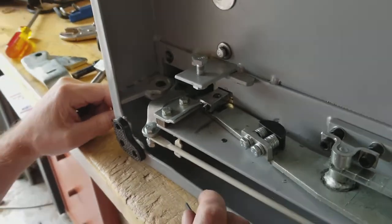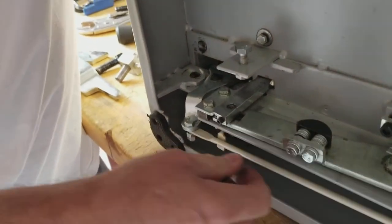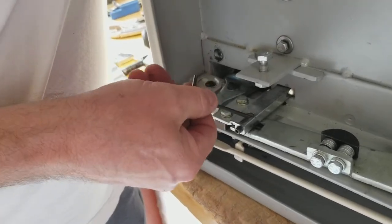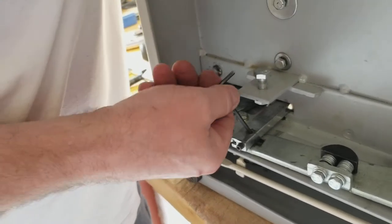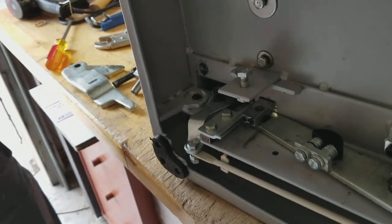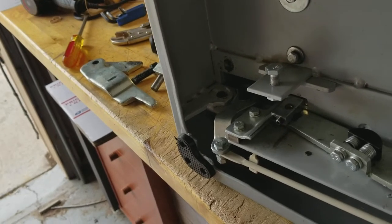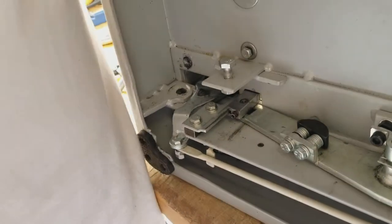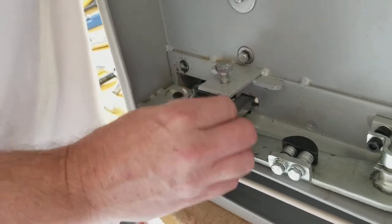It seems like the post went down on that side. What you're going to have to do is get that post out of there. You can push down on the clamp from the top like I showed you. To extract the post, you can thread a 7mm bolt into it and just pull it straight out — that's an easy way to get these out.